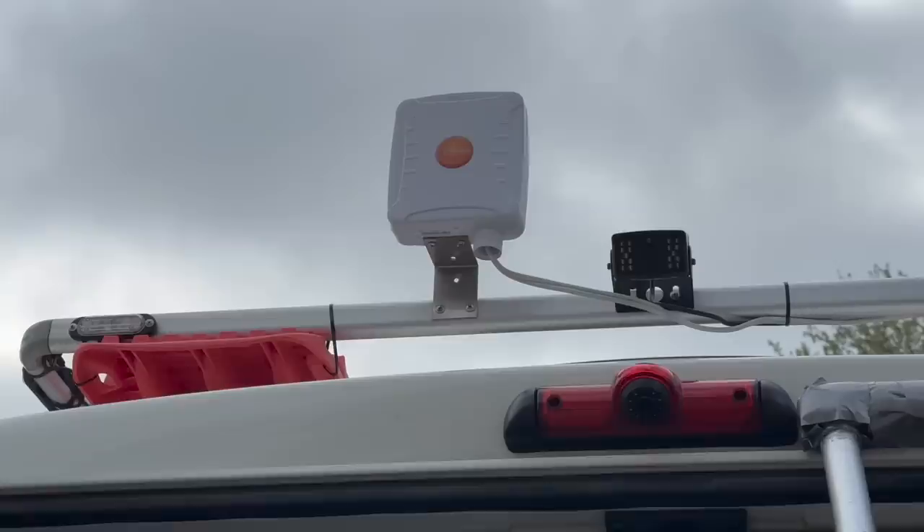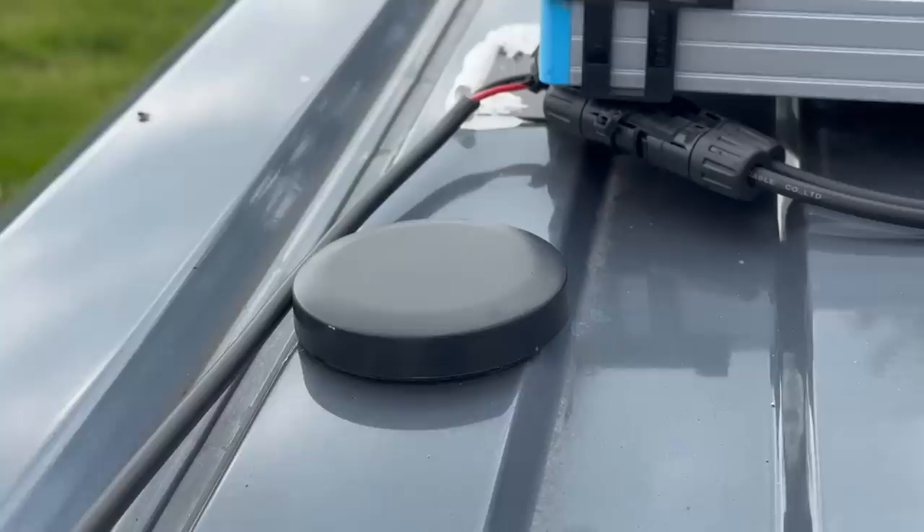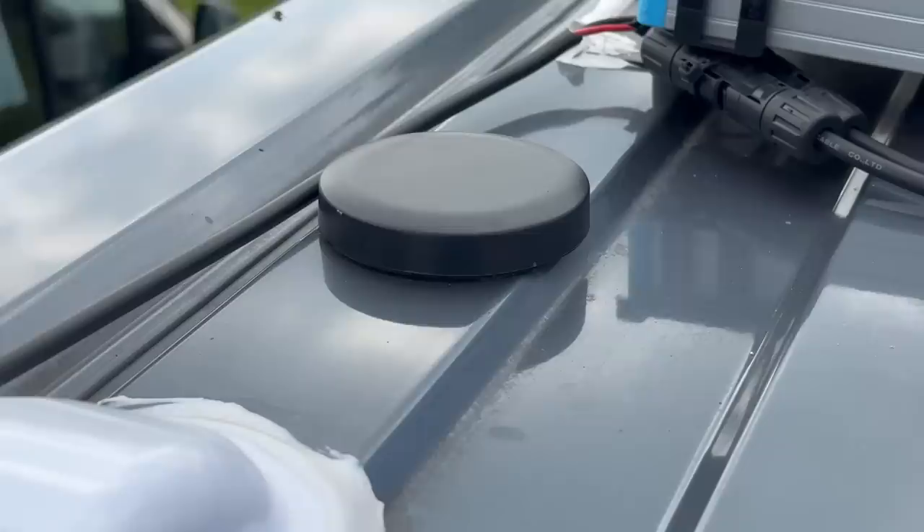When you're inside your van at night time with all your blinds down, you're going to really struggle to get a connection on your phone. You're in a metal box, and most blinds are backed by foil or something like that, so you create a signal-blocking box called a Faraday cage when you're inside your van with all the blinds down — which is why you struggle. Therefore, you need an antenna outside the van, and you can do this via two types. You can go extreme, which is a full omnidirectional 5G, 4G, and 3G antenna up on the roof to get as much signal as possible wherever you are. The other option is a puck antenna.